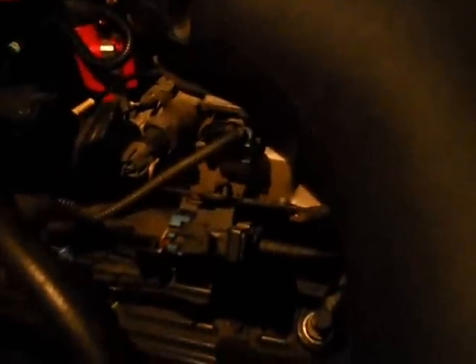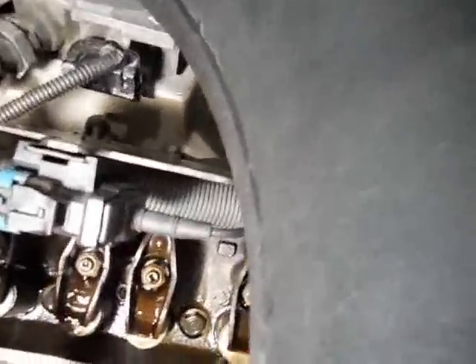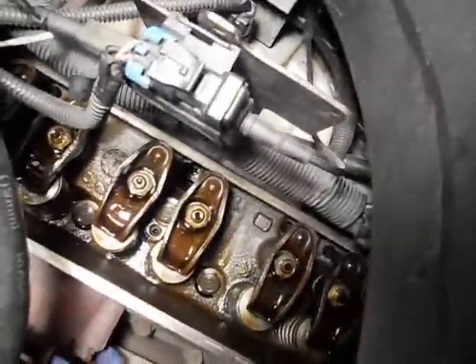Moisture — I don't know. This brick has to come off too. Alright, so the last video explained what I found and now it's a diagnosis. Had that cover off, the old push rods have been nice. Took the old thing out. On the passenger side, I just ran it but I'm not going to make a video because it makes too much noise. And all the push rods spin — that indicates that the lifters are not flat. I want to look at that little piece right there — so much chunk.